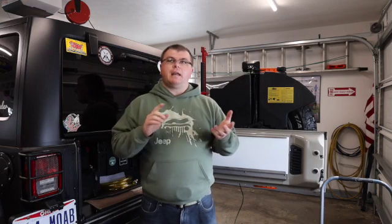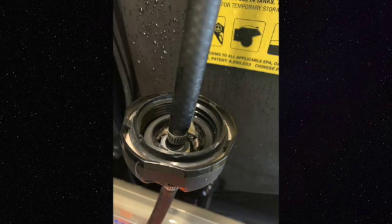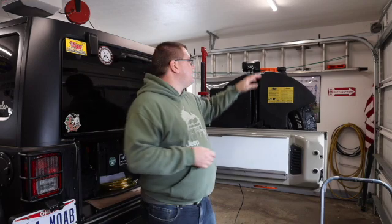I'll try to go step by step as much as we can. I already drilled the bulkhead fitting - that's a pretty simple step. I used my drill press, tried to get as centered as I could, used a step bit, then put some epoxy filler around there just to seal it up since it will be exposed to weather. There's a cap on the top where I screw in the new fuel line.